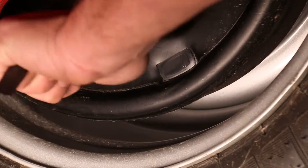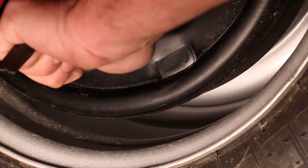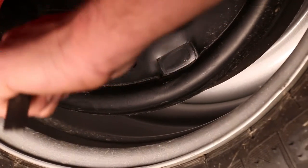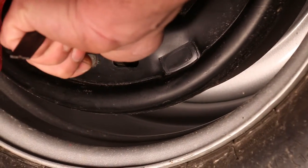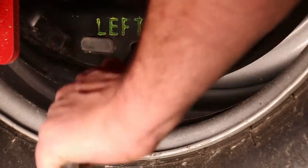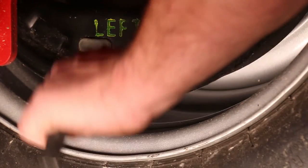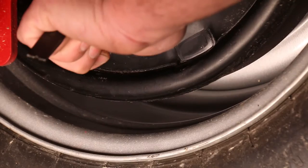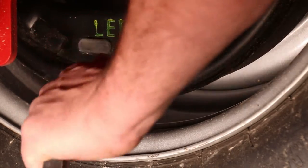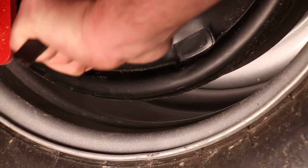I'm going to rotate the wheel up, pushing the handle down until I can make it no tighter. It's at the point now where it's getting hard to turn the wheel. We'll keep tightening it up. The reason we're tightening it is so that when we loosen it off, the brake pads are loosening evenly. It's basically a reference point if we go all the way tight.